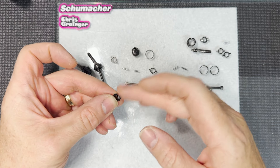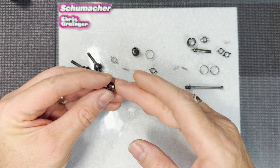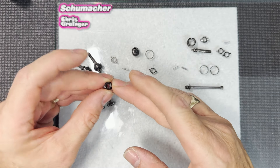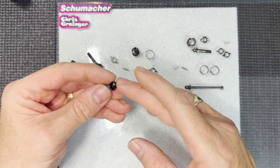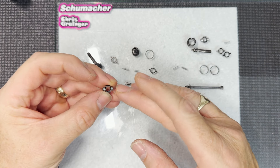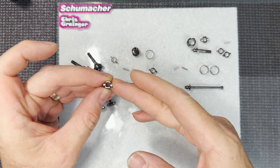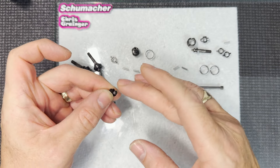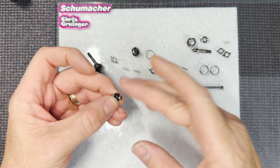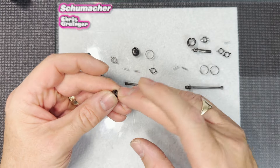There's no need to grease this - just leave that all dry. The bearing is not going to turn on the pin so it's best to keep that dry. For maintenance I wouldn't really ever take this apart again unless there was a breakage, a broken bearing or something. I would leave this basically for the lifetime of the driveshaft, the lifetime of the car. For cleaning I just use a toothbrush and a bit of tissue to wipe it down. I wouldn't soak it in brake cleaner because you just wash more dirt into bearings than you take out.